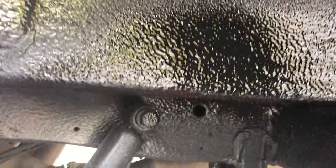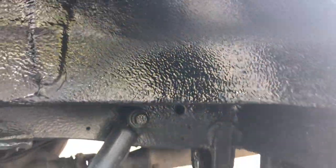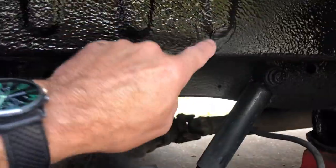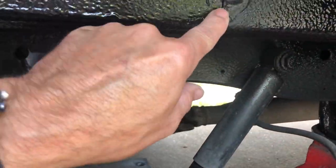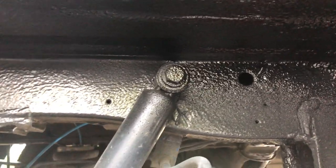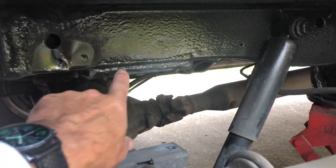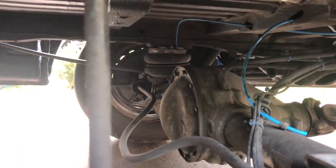All right, pretty much the same sort of texture. I'm quite happy with that and I've lapped it underneath. You can see the lines — I think that's good enough. I'm extremely happy with that, it's almost like an invisible repair. That coming out there is just the original. I was thinking about rubbing it down but yeah, dirt can collect in there — I'm extremely happy with that. Now I'll wait for this to go off a bit and then cut this off, and in the meantime I'm going to take the other airbag off.